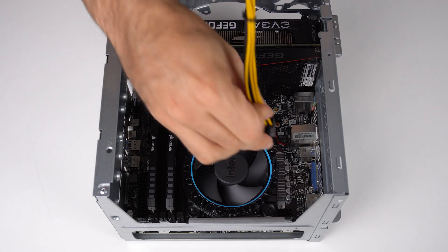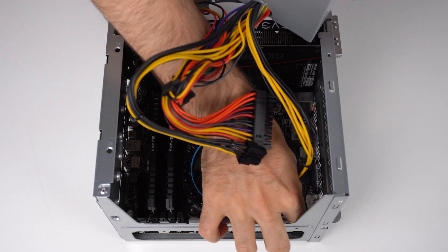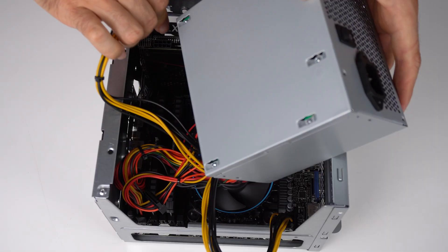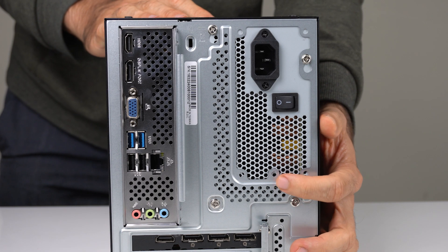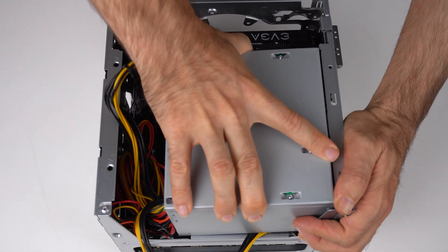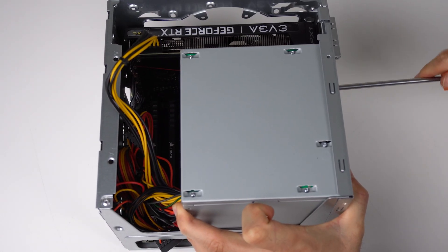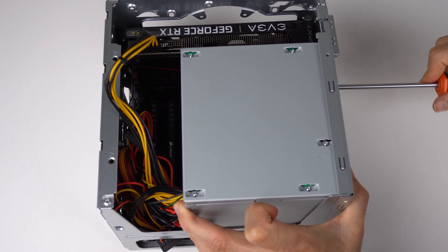The last piece of the puzzle is the power supply. It's custom, with only the cables you need, including an 8-pin for the GPU. They're also shortened to not fill up the tiny space. The fan on the power supply is reversed to draw air onto the CPU cooler. The DeskMeet does support mounting an SFX power supply, which increases CPU cooler height to 63mm. But how well it will do if you don't reverse the fan is anyone's guess, as I don't have a spare SFX to test with. Custom short cables would be really helpful if switching to a different power supply.